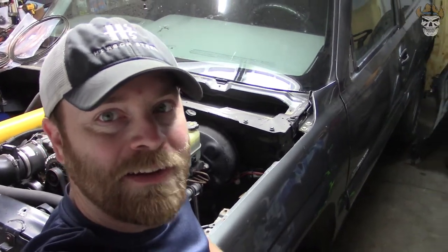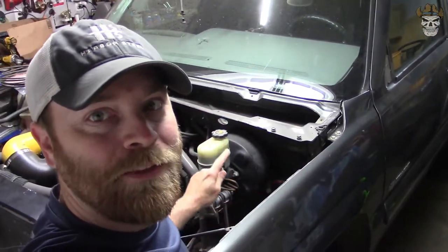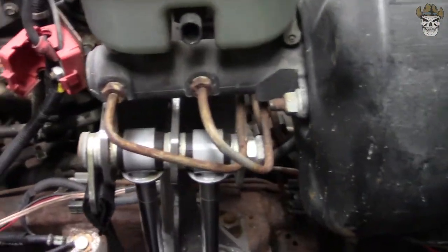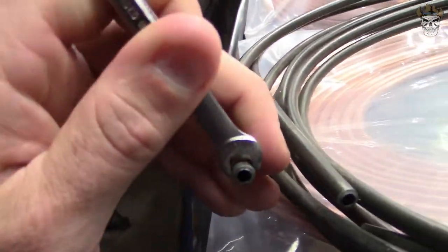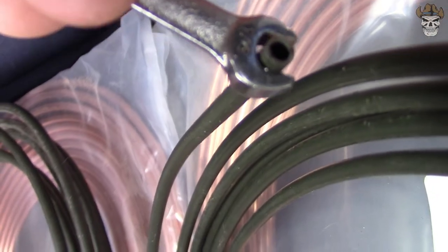Today I'm here with a Disaster Transport and getting ready to replace my brake lines. I have pretty rusted brake lines so it's time to address the issue before it becomes a problem. First I need to figure out what size line I have. I take a quarter-inch wrench and slide it over the top of the line — that tells me I have a quarter-inch line. If it's too loose, I'd have a three-sixteenths brake line.